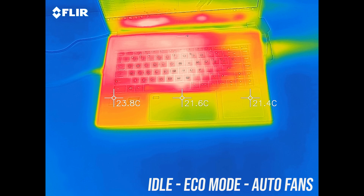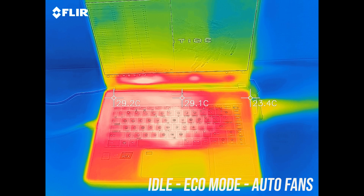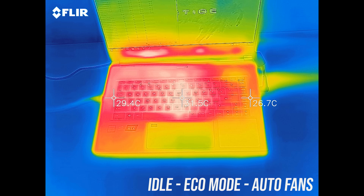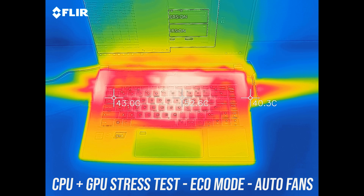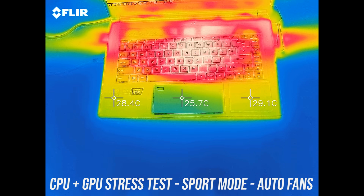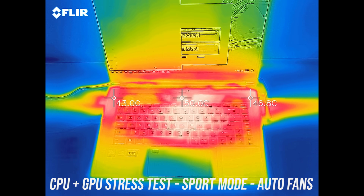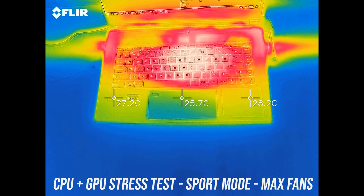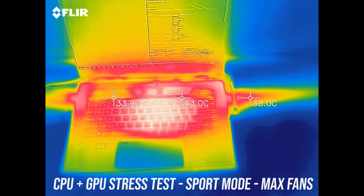As for the external temperatures where you'll actually be putting your hands, at idle it was barely getting to 30 degrees, which is pretty standard with most laptops. With the stress tests going in Eco mode, it does get quite warm in the center. The fans are quieter in this mode and it's thermal throttling. Things cool down just slightly in sport and turbo mode. However, as we saw, performance is much better now. Finally, with the fans maxed out, it's now a few degrees cooler, but at the expense of higher fan noise.